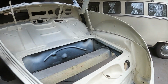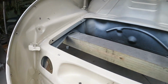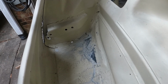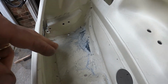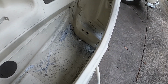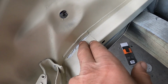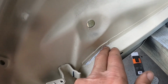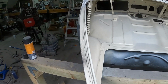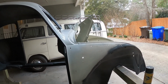So I'm getting everything dirty on the inside of this where I had already painted. Plus I had some issues here where some of the primer had I guess welled up and got so thick that it's not drying properly. So I've got to figure out, at least it's coated with something. I figure eventually it'll dry, or I'll go over this with a bunch of mineral spirits and get that out. But you can see, like here for example, the primer wasn't dry when I put the Lotus white on, and then it split, doing some weird behavior. So it's all about patience, I guess, when it comes to painting, and I don't have enough of it.